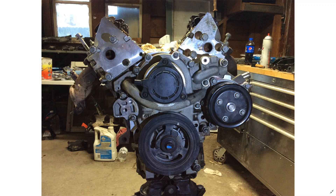The coolant crossover goes from here to here, basically crossing over — it's a coolant crossover. This pushes coolant from the engine to the radiator and back, and the coolant ends up at one head then crosses over to the other head. That's basically what that crossover is — just to transfer coolant from one head to the other. Pretty simple. If you put this crossover on first, you won't get that rear valve cover on — not going to happen.